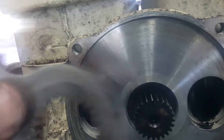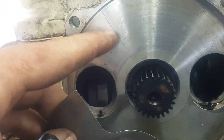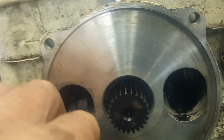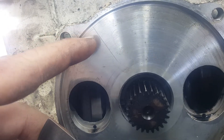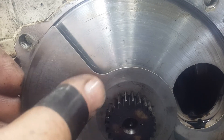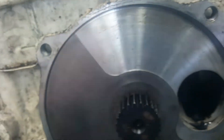Turn to 147 and make a mark — this one's already marked — then remove your timing wheel and get your rotary valve. It can go on both ways. You want to get as close to your mark as you can. This setting can vary five degrees, so if you're not right on the mark it's not going to matter, as long as it's not out more than five degrees — if it's out more than five it's going to cause problems. Try it one way first and see how close it is. If it's far away or over the mark, flip the plate over. Whichever direction is closest to your mark is the one you want.